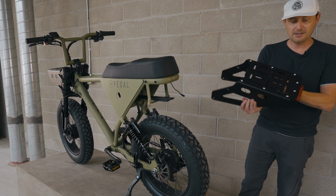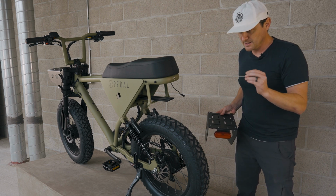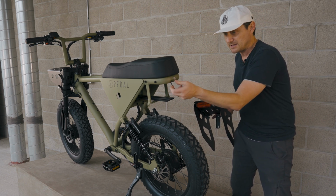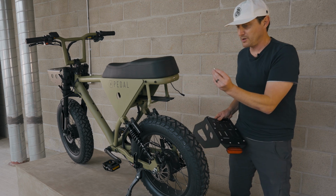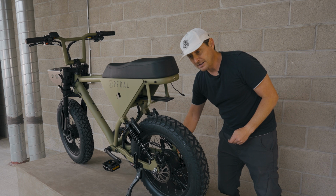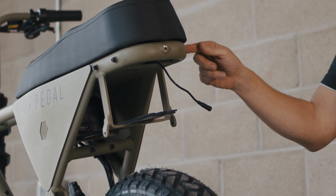Okay, I've got my Eco rear rack ready to install on the bike. I've got the hardware that came with it ready here. That is a very long M5, and that is gonna go through the riser, through this hole in the frame, and utilize a washer and a nut on the inside. And we have 4 shorter M5s, and that's going to use our original mount point from the other rack down here. And if your bike is one of the newer bikes that has the extra bolt holes along the frame here, it's gonna utilize the rearmost one on each side.